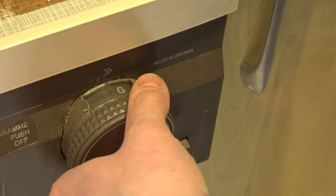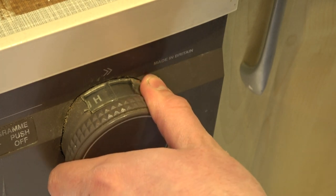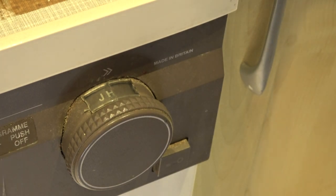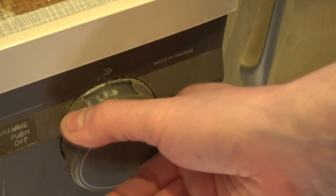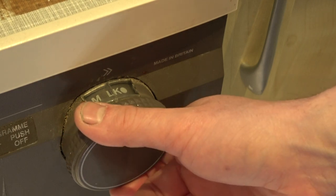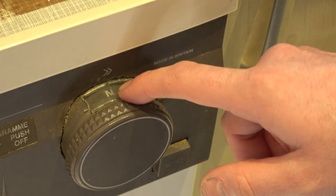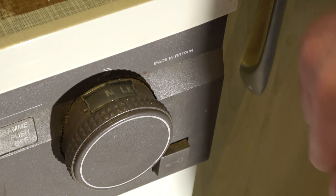Then it will do rinses, 1, 2, an intermediate spin, 3, another drain, and then finally get to program H, which is your final rinse, your fourth rinse of the cotton cycle, then program J, which is your 1100 RPM spin, then off, then program K, which is your white nylon at 60 degree program, then you got your minimum iron program on program L, in conjunction with quick wash, it'll be your 30 minute program, then you got your program M, which is actually the cool down section of the minimum iron section and white nylon section.